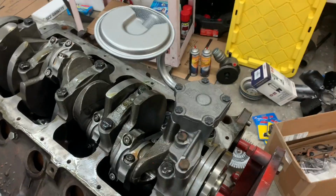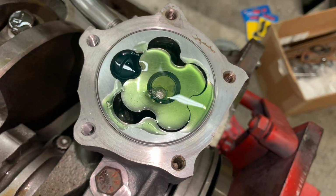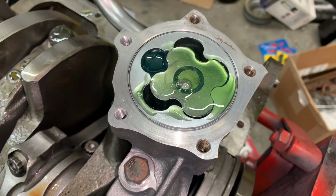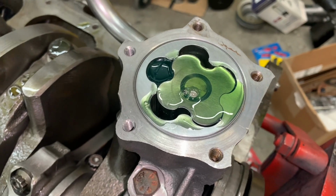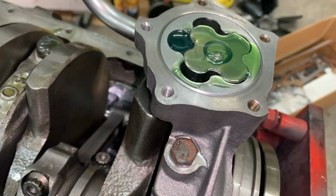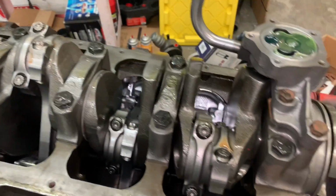which I will show you right now. Filled our pump with assembly lube. So when we go to prime the oil system, we'll have a little extra suck. And that assembly lube also will get pumped through, which will help protect our bearings and all that good stuff